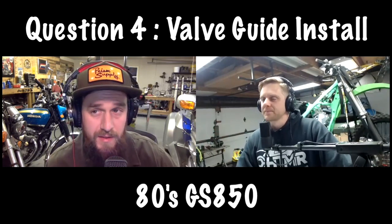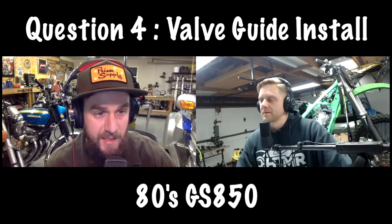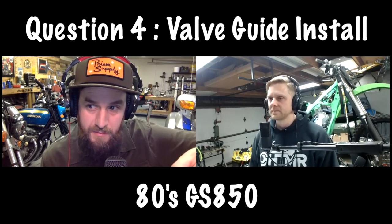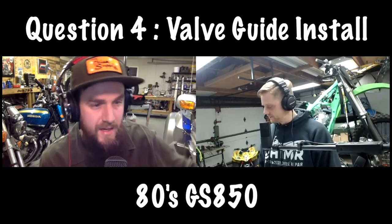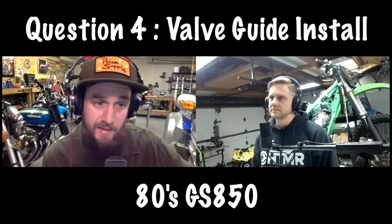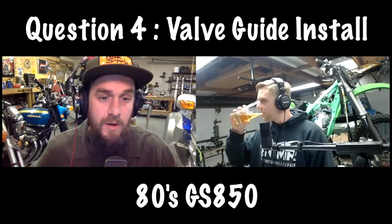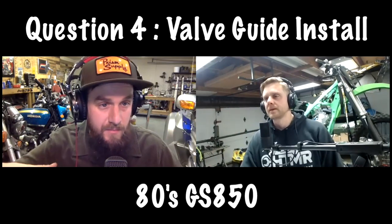The tool that you install them with is going to be something that goes inside the inside diameter of the guide to keep it straight, obviously, and then something that goes around the flange, the seat of it. With the hot head and cold guides, it's going to go in pretty easy. It's not going to be very difficult, but you're going to tap them in until they're seated. Tap, tap, tap until you hear a noise change, and that means that they're seated.